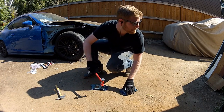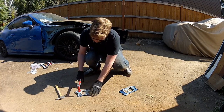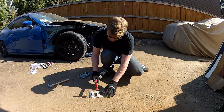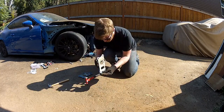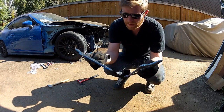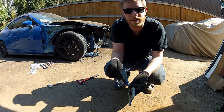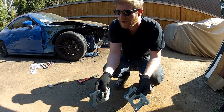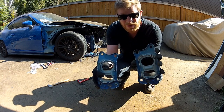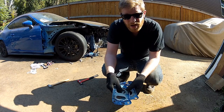Yikes — kind of destroying my driveway. I got both pieces pretty straight, but I kind of screwed up my driveway. So if you're doing this at home, get a piece of steel or something to put under it. I just didn't have anything and it's too hot to care about it — it's not my driveway anyways. I'm going to go back over these footprints with the angle grinder and cut off some of the leftover pieces, then grab the cutting saw and start cutting our pieces of pipe to build the bumper with.